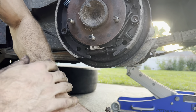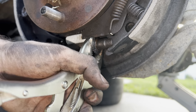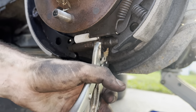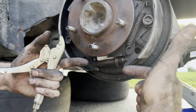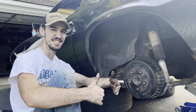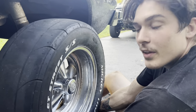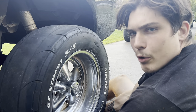What we're doing is adjusting the self-adjuster — not really the best way because we're putting a tool right on the teeth, but we're getting it done. Basically what we're trying to do is tighten this so it will compress and bring our shoes in. Both of the drums are complete. Now it is time to put this on the ground and do the smokiest burnout you've ever seen.